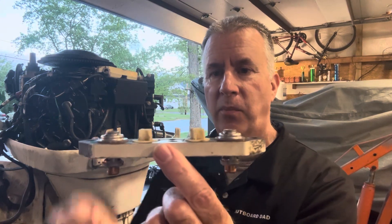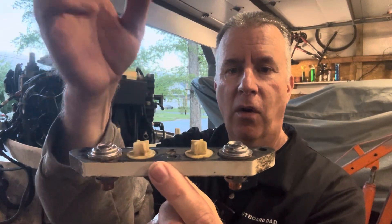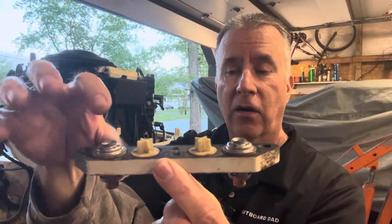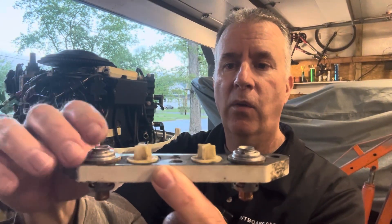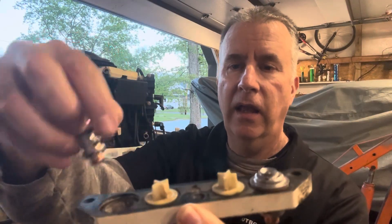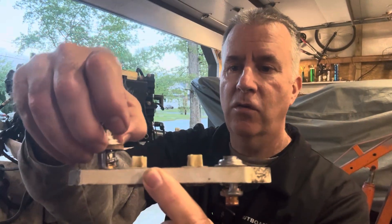Here's our mid part with our poppet valves. There is a rubber ring in here — there's nothing wrong with it and they're not binding. And our thermostats have a little cork gasket in there and they only go in one way. There is a little ring on one side but not the other, so you can't screw it up.